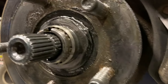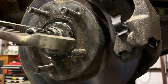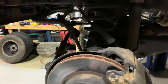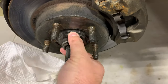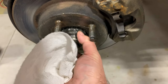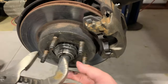Keyway is out of the way. Now we should be able to slide this nut back perfectly easily — and it did. Now we can get it with our hand. So now we're just going to pull this thing off here. There's your bearing coming out of there. It's a good idea to go ahead and repack this bearing, or replace them if they're shot. You've got an inner bearing also, so you have to take the brake off and the hub out to get to that.